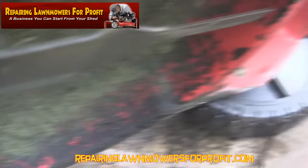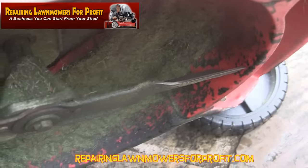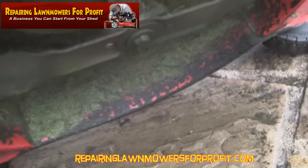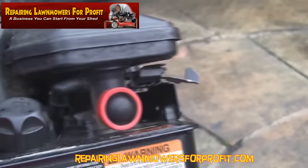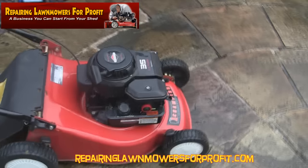They're actually on right. I like to see that as well. It means it hasn't been smashed. Blade don't look like it's too badly worn either, although we'll sharpen that up, clean a bit of this mess up underneath. No drive on this one, just a simple one, and my guess is it's just going to want this carb servicing up, just wants a diaphragm and gasket changes.